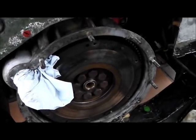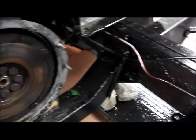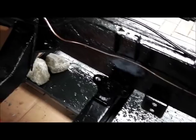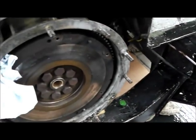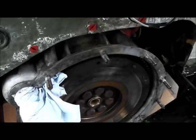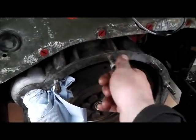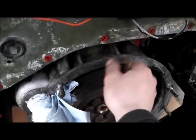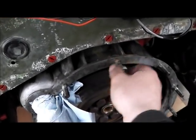Just a little point — one of the quirks of Series Rovers. All the bolts in the chassis that hold the engine mounts, for example, are imperial. Bear in mind this is the original engine, but this is an M10 nut — modified at some point — and you can see it fits perfectly. All metric threads on the engine.